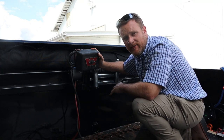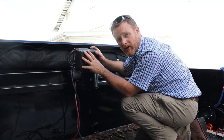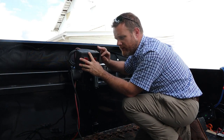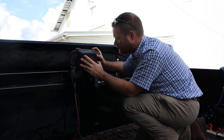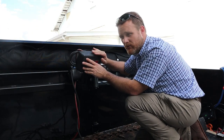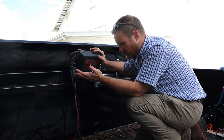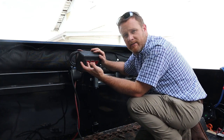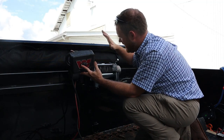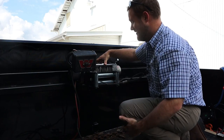Based on my limited understanding of the upgrade kit: the way the old controller worked is you basically have solenoids inside, and depending on which direction you want the winch to go — in or out — different solenoids fire to send power to different sides of the motor. With the upgrade controller, that all goes solid-state, so no more solenoids. Solenoids, although they were great technology for their time, are a little troublesome — they'll go out on you. Not that hard to replace or diagnose, but they do go out. So I'm going to remove this box and then mount the new one on top of the winch. It looks to be a super easy install, so let's see how long it takes.